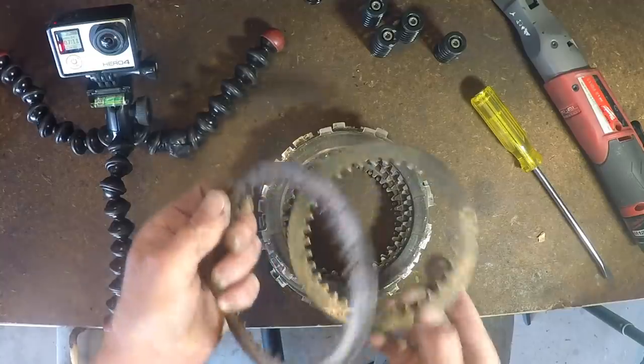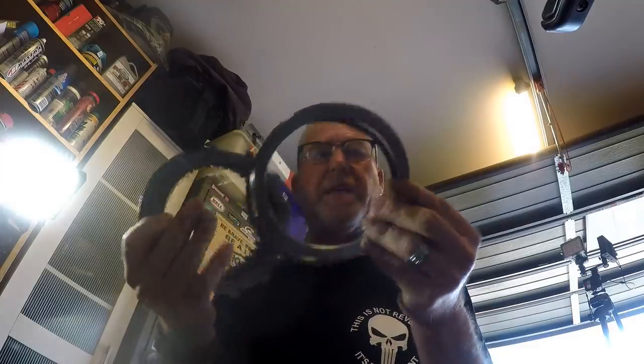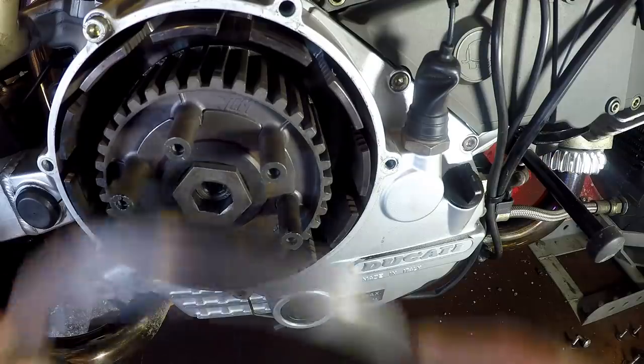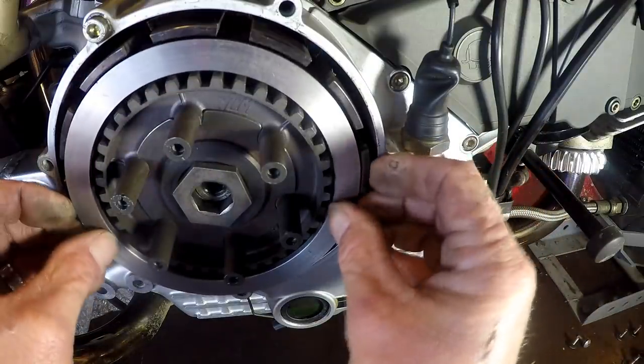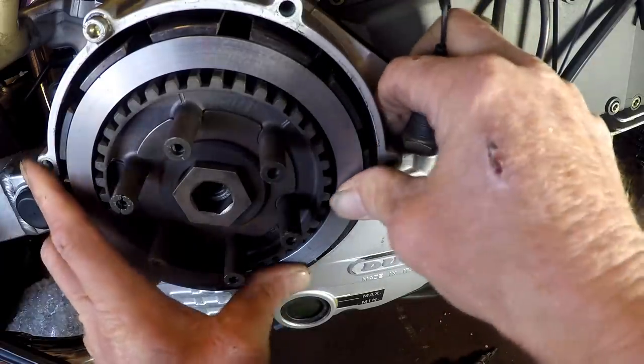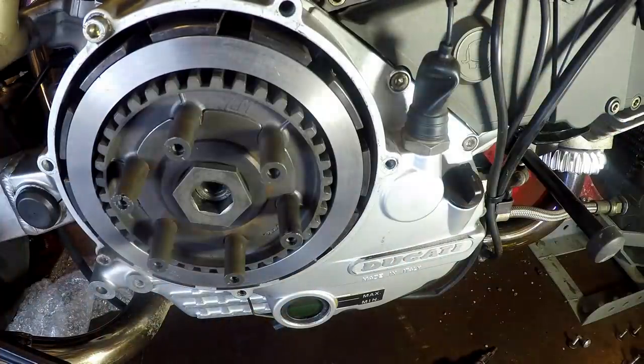There is a curved one - one of these is pressed slightly. So this is the new setup. What we've got is this spacer disc, and this spacer disc is supposed to go in here - it is tight in the basket. He did tell me that you'll have to tap it in, and if it was an aluminium basket you'd heat it up to expand it.